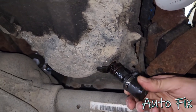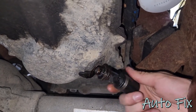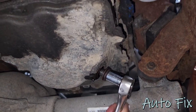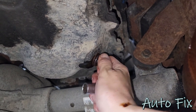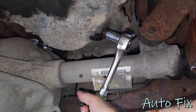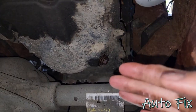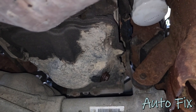The oil is down to a slow trickle so it's time to cap it off. I'm going to put the drain plug back in. Typically you want to replace the gasket on it — I usually reuse them a few times and it's fine as long as it doesn't leak. When you tighten it, don't go crazy — just give it a snug turn. Drain plug is in and it's tight, oil filter is in and it's tight.